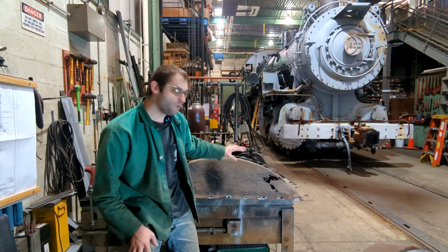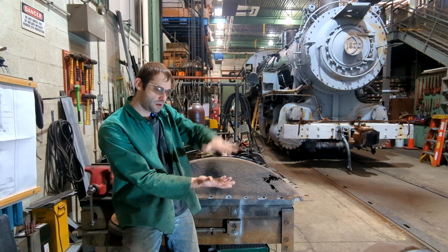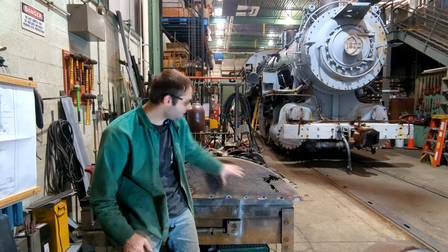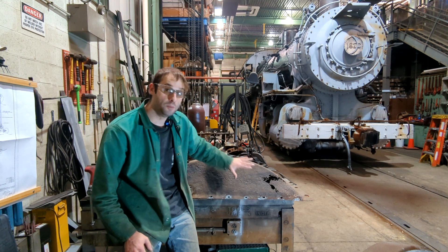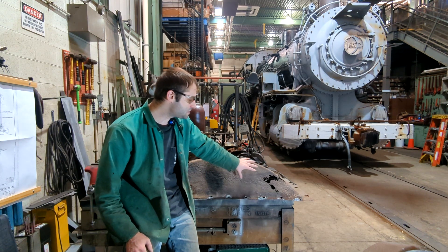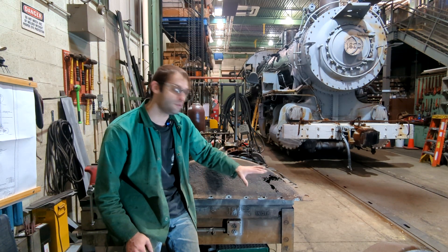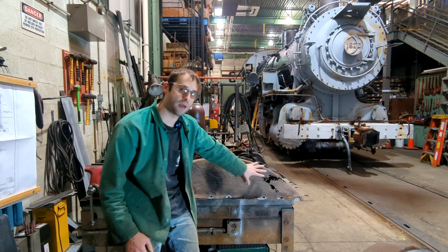When these were made they would have been pressed — a flat piece of metal would go over a form to shape it, giving you all different kinds of curves and radii as you can see here. So for me to replicate that from a new piece of metal would be very, very difficult. What we're going to do is work on this piece today, showing some techniques on how I can patch this and make it look like it's not even patched, without having to worry about rolling the piece of metal that I put in.